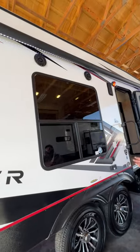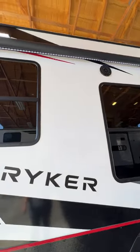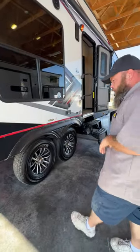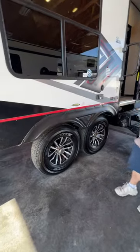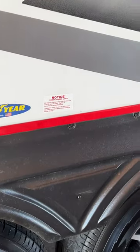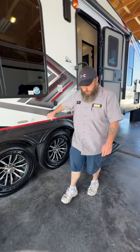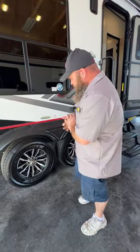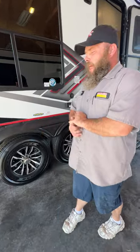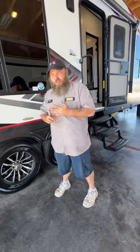We've got our outside speakers on. As you've probably noticed, there are some extra little lights around the coach — those are going to be security or scare lights, located on your control panel. Next we're going to have our tires. As you can see, there's a check-lug-nuts sticker — it's even on your door telling you to check your lug nuts before you leave. I like to call this our overaggressive sticker because it wants you to check them at 10 miles, 25 miles, and 50 miles — most other stickers say 50, 100, and 200 miles.